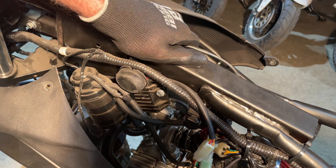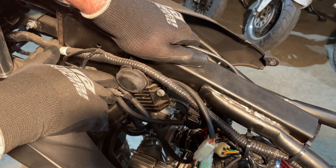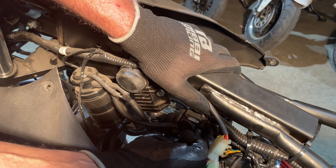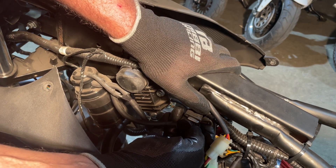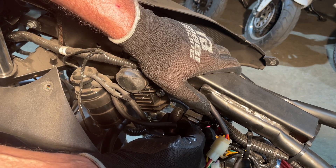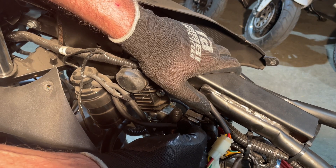This one here would go to the airbox, and down here there's another one from the engine that would also go to the airbox, but the airbox is gone now so you have to leave it open. The ones from the charcoal filter still run down here. This one right here is a check valve for the gas tank, so it gives air back to the gas tank so it can still run. There's a hose that goes to the bottom of the gas tank and that's what this line connects to.